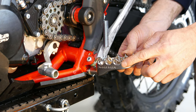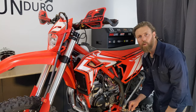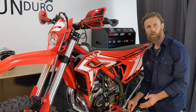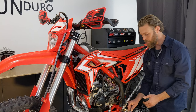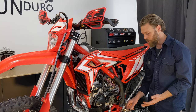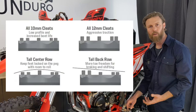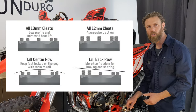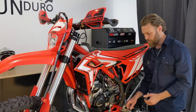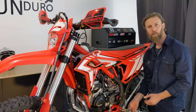The last part is the studs, which are just loosely in here at the moment. There's a 10mm and a 12mm stud option. You'll want to use the Loctite provided and screw them all the way down into the base. There's a bit of debate on the forums about what height to use — some people use different heights in the middle and outside rows for different levels of traction. I'm just going to go with the 12mm throughout and see how that feels.